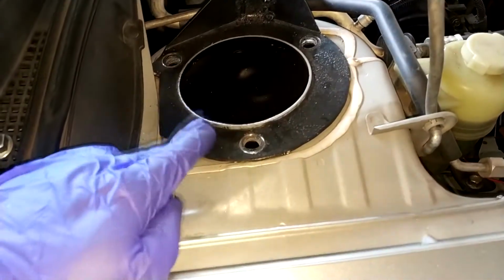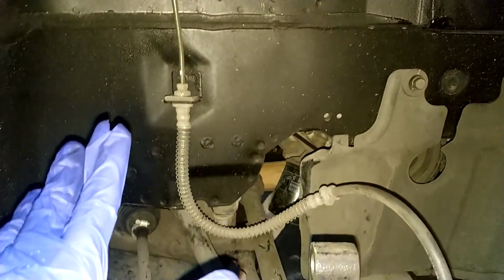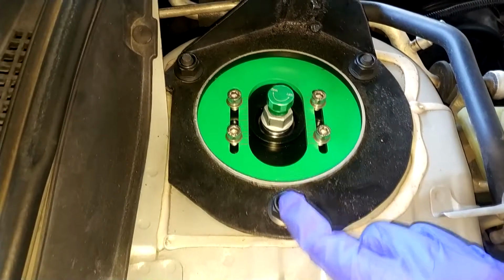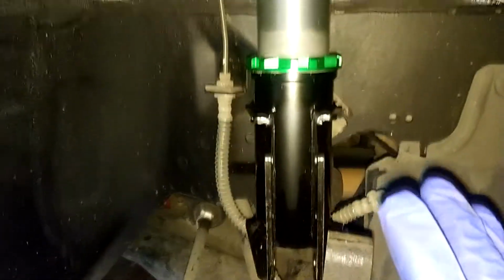So you can see I take out the strut with those three nuts and these two, and now I'm going to show you how to put in the coilover, because there is a specific way to put it. So before putting the coilover, we need to take out this bracket with a 12 millimeter socket and put it in there. So I just put the coilover here with these three nuts. You can see these black nuts here. I just do not tighten anything yet. You can see here's the coilover,